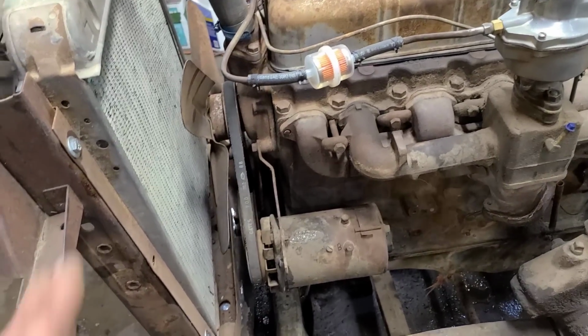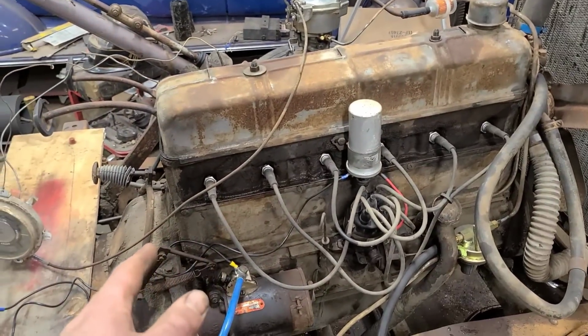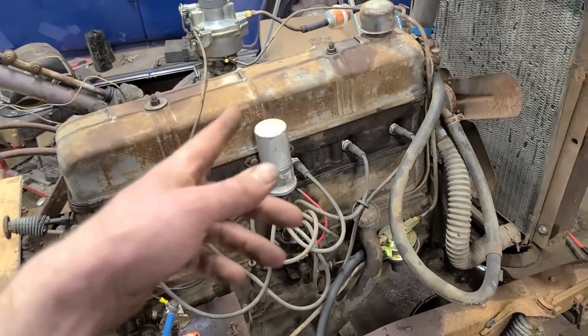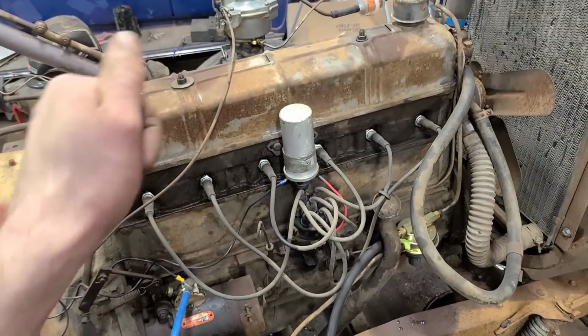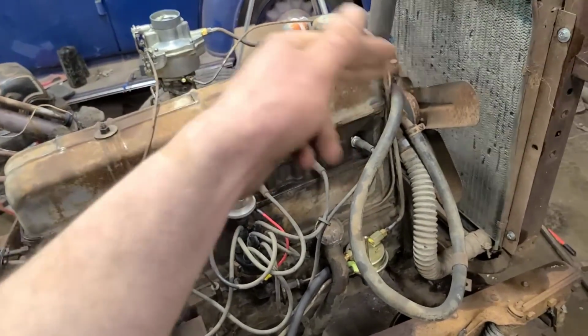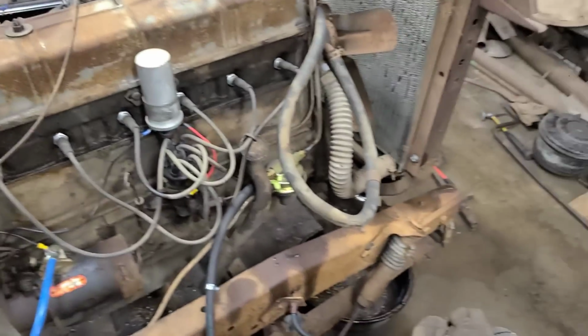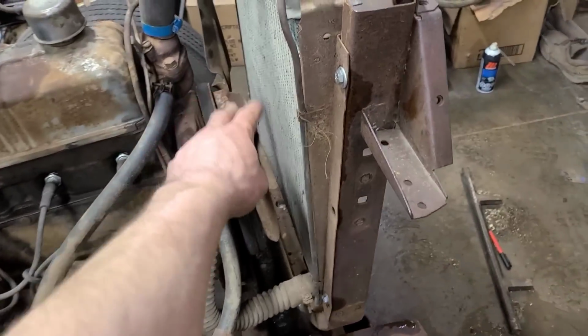Other things we've noticed, or observations that we've had. I think this thing was hard to start originally for a couple of reasons. First of all, I think we already mentioned it, but the plugs were getting fouled from all the oil we dumped in. That was a problem we created for ourselves, but I think it was the right decision to pre-oil everything.